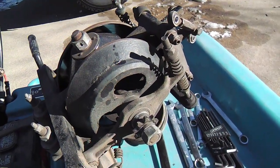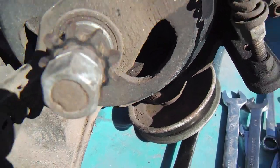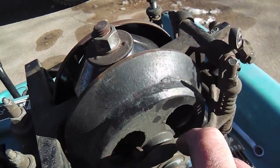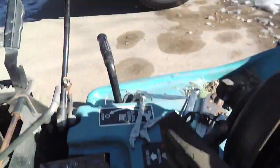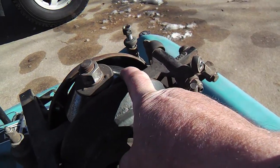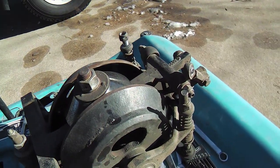I think I had the seat up when it's stationary, and notice that first of all, the sheave or the pulley down below is belt driven off the motor, and obviously it turns these cones. There's one up top and one below, but these discs or cups, they don't both push against the top one to move it forward. When you hit these two levers here, these two levers forward, what's happening, I believe, is one of them is hitting the upper cone, and as you're also pushing the other lever forward, it's going in the same direction the disc is, but it's engaging the lower cone.